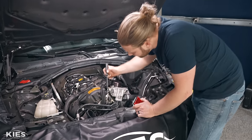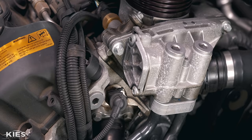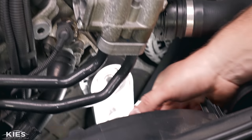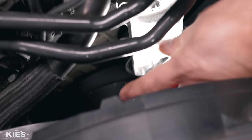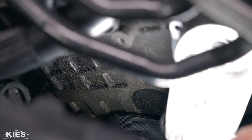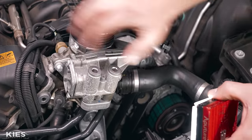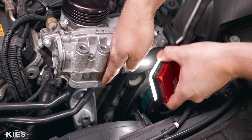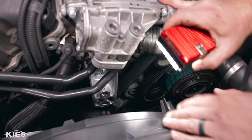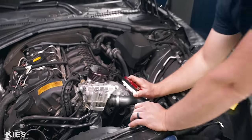If you look over here, this right here is actually where your oil filter housing gasket lies, and as you can see it's kind of nasty from oil. Worse off, if you look under here you can see all of the oil that has sprayed all over the motor — it is disgusting down there. The problem is the belt sits down here and you have oil in the cooling unit right here. Once that starts to leak, oil will drip onto your belt, causing it to slip off the pulley, get sucked in through the crank seal, and cause catastrophic motor failure.